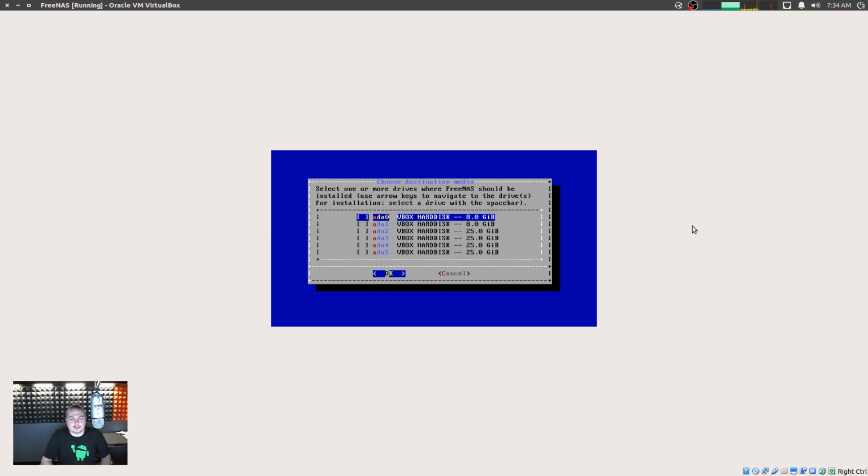Now, this is what I was talking about to select RAID. There's no real configuration you need to do. If you select 2 devices, those devices become the RAIDed devices. As simple as that. Now, they're all labeled in here, ADA0 and ADA1. I believe in FreeNAS, they're DA0 and DA1, which is referring to the USBs. In this case, because they're all connected to the PCI bus.